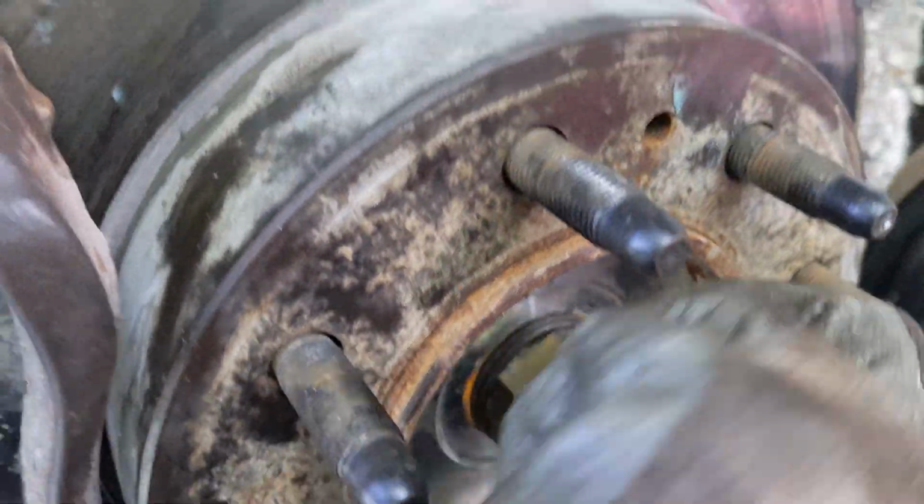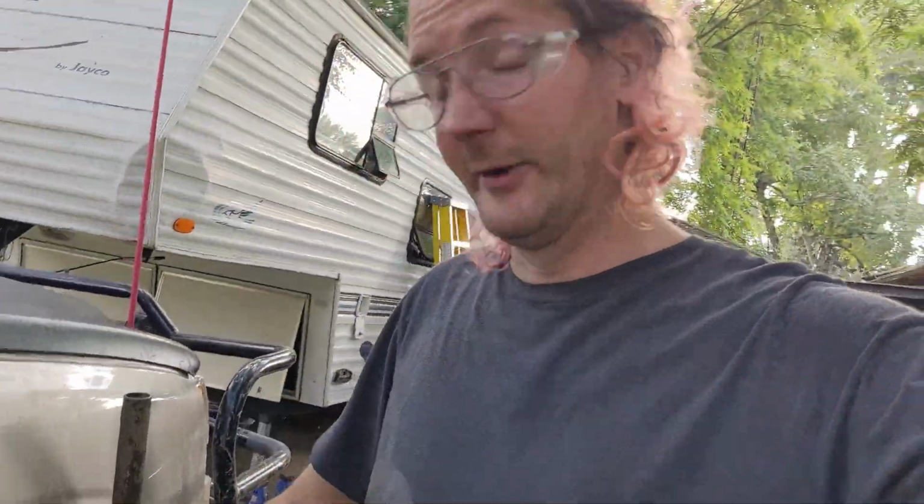But I found something out. I know one reason why the ABS light is on. If we come down here, I don't know if you'll be able to see it. Oh, yeah, right there. The wires have rubbed through right there, somehow. This is the speed sensor wire. And it goes to a little sensor down there, and on the inside of the bearing here, it has teeth and spins around and counts them and blah blah blah. And so that not working at all would be why I don't have ABS or things like that. But basically that's why those lights are on.